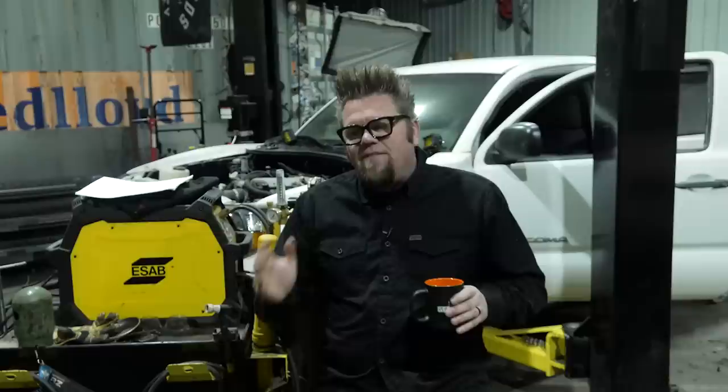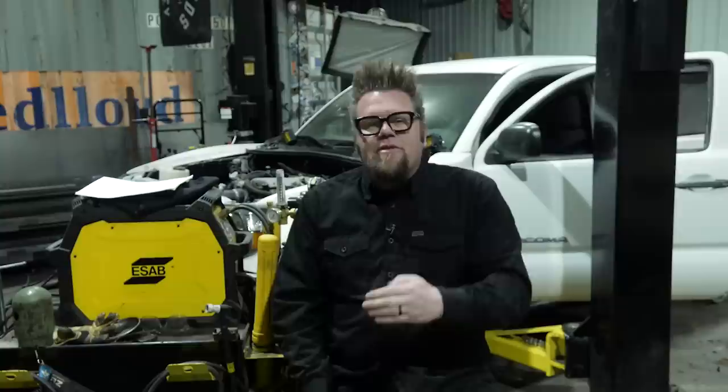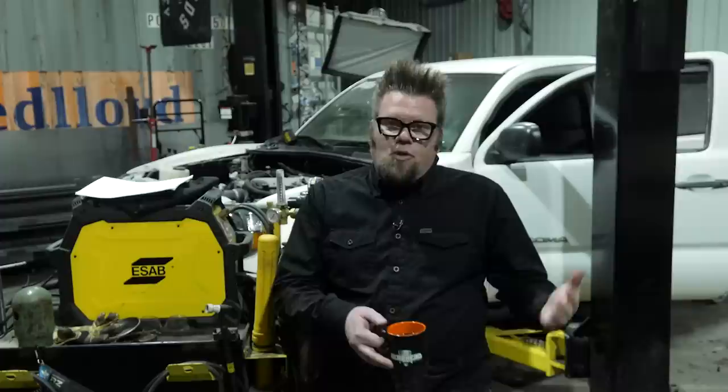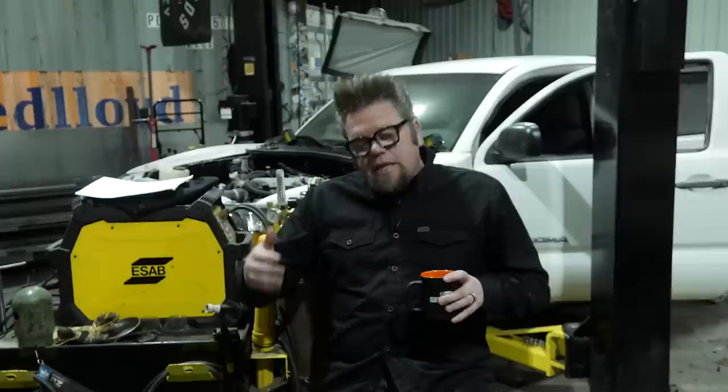I got a Savvy Off-Road TJ skid and worked on fitting it inside the factory JK frame. To do that I had to eliminate a body mount. On the Willys wagon I could relocate it — the rear-most body mount is on the inside of the frame at the rear cross member, so I moved it to the outside. That wouldn't work well on a standard JK because relocating that body mount is a lot of work. But it's possible if you're using the JK frame for a custom project.